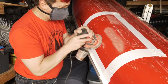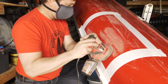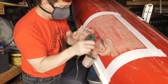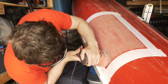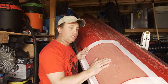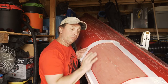I'm going right to the fine grit right away. I sanded the whole area down because whenever you're doing repairs, you want to go a little bit bigger than the area you actually need to repair, and we're going to paint this all up too when we're done.